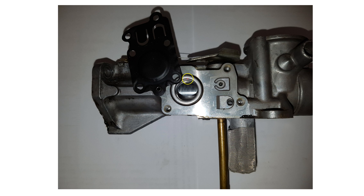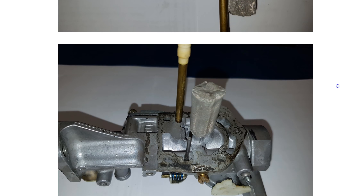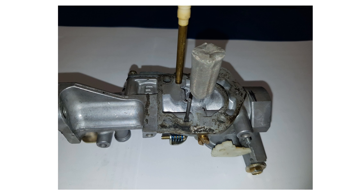You can see the spring and the cap there, and this is the valve. This hole here runs all the way down to the bottom of the fuel tank — it goes right down to the very bottom. This little hole here doesn't run down to the very bottom; it runs down and drains through a little hole that goes into the fuel cup. That little hole it runs down is right in there, so it just pours right down once it's done with the pump.